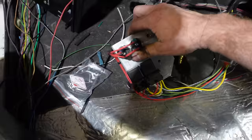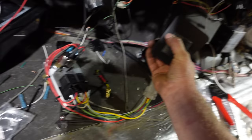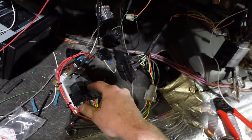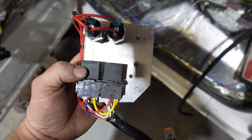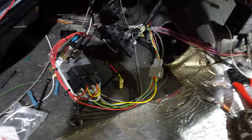The sensor is coming in, the relay is nice and neat, and I have a nice little plug. The switches work the way they're supposed to — up, up, down, down. The relay ground needs to be hooked up, so I'll bolt it in place, make sure they've got the grounds, confirm it's doing what it's supposed to, put some loom around it, and finish it up.